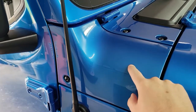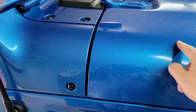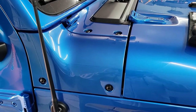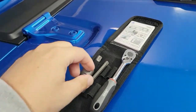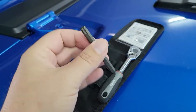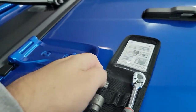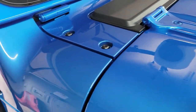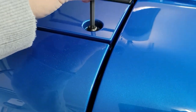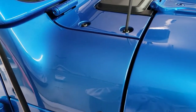The next thing we're going to do is pull this piece right here off. This is going to give us a path to get from inside the Jeep to under the hood, which we need for our power. So remember that little Jeep kit — we need the Torx bit from it, which is a T40. We'll use these to take out the four bolts on this cover piece. I'm going to go ahead and pop them out real quick, put the camera down, and then I'll show you how we get this piece off.